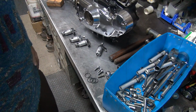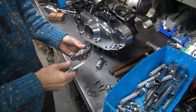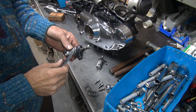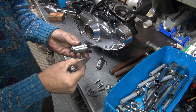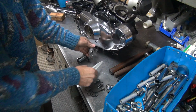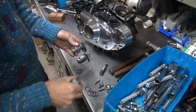Okay, we now have 4 O-rings. That's a good sign, because we needed 4 O-rings. Okay, now we've got to go ahead and not lose the lifter. We need to get rid of this O-ring right here. Preferably without cutting myself. Now these are still pretty good, so we can reuse them. Oops, appears to have a cut in it. I guess we have to throw it away now. There's really nothing wrong with these, but yeah, we got new ones.